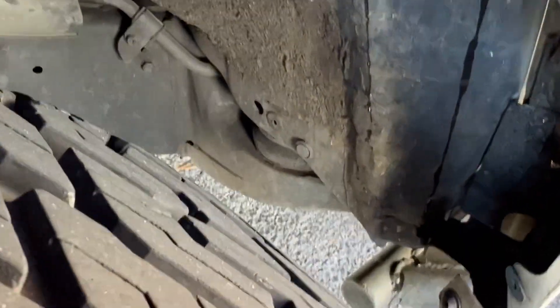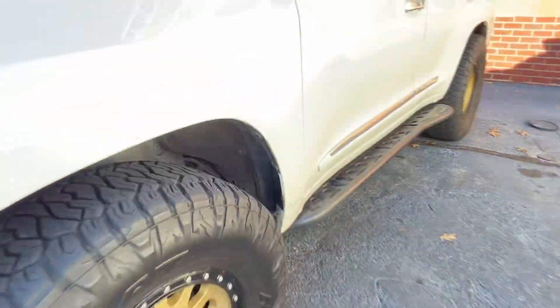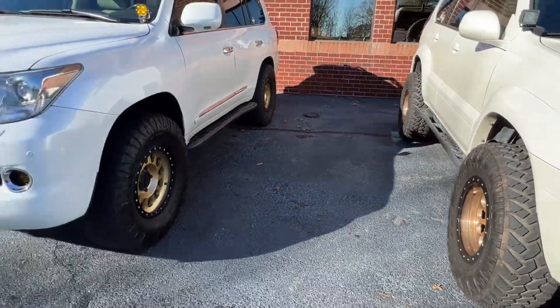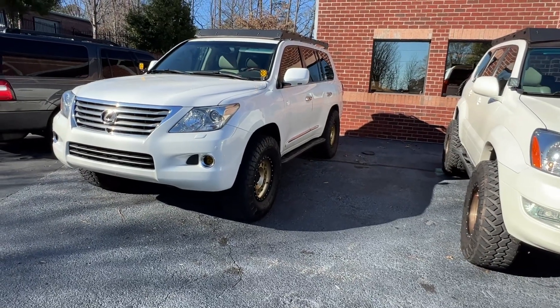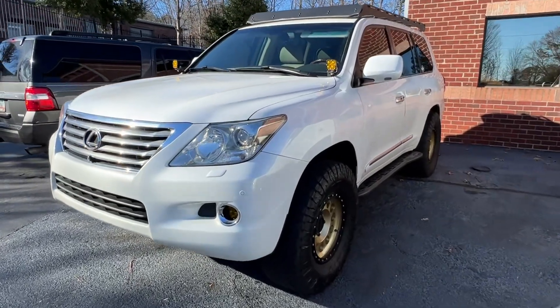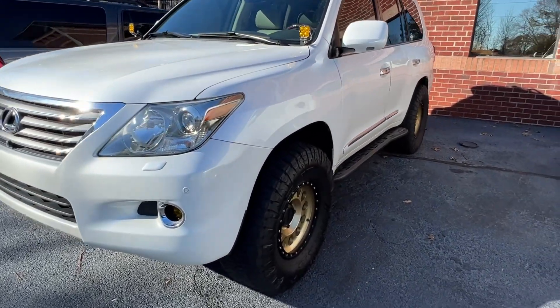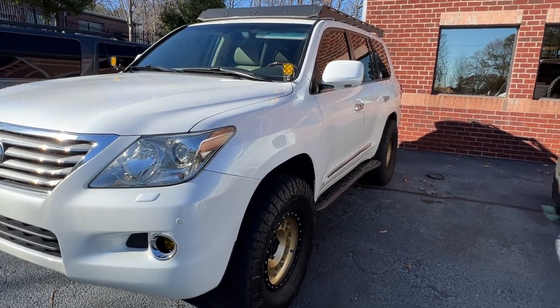Another Torx Fabrication body mount chop on the LX. The 200 series versus the 120 series — kind of think of it like a Ford truck where you've got a 150, 250, and so on. The 200 series metal is much more substantial. It's a heavier vehicle, the pinch welds are a lot harder to flatten out, and the steel seems to be heavier gauge.